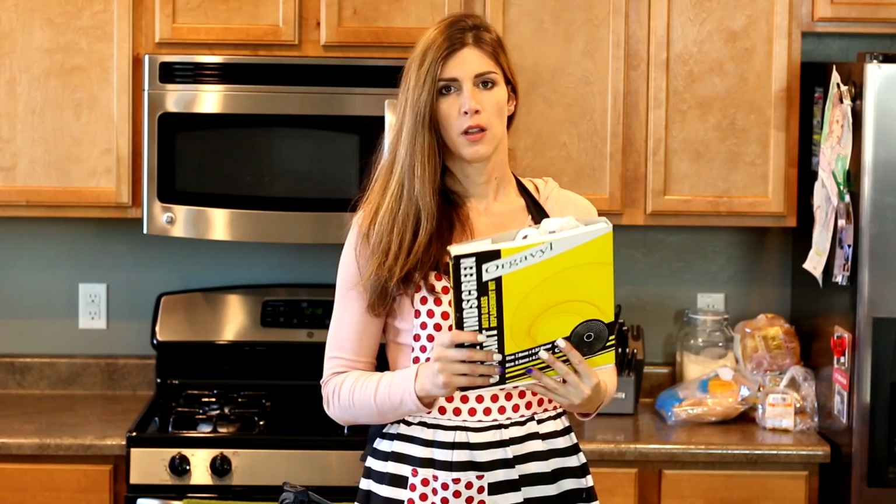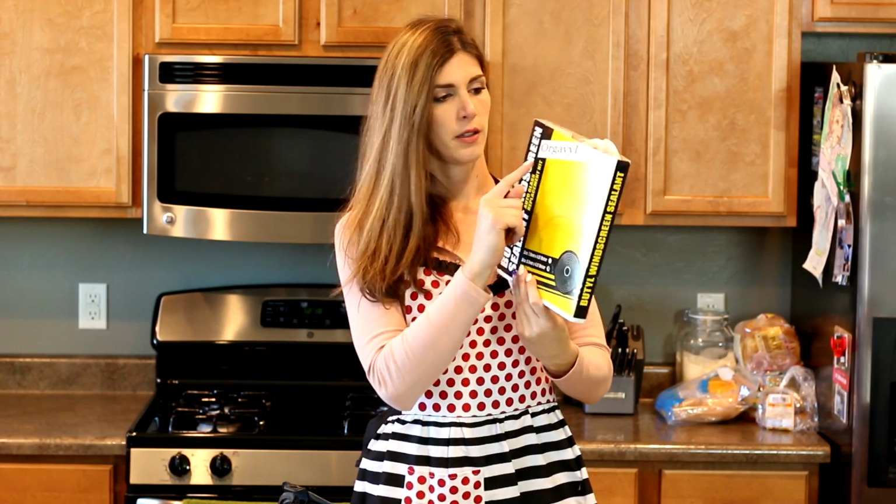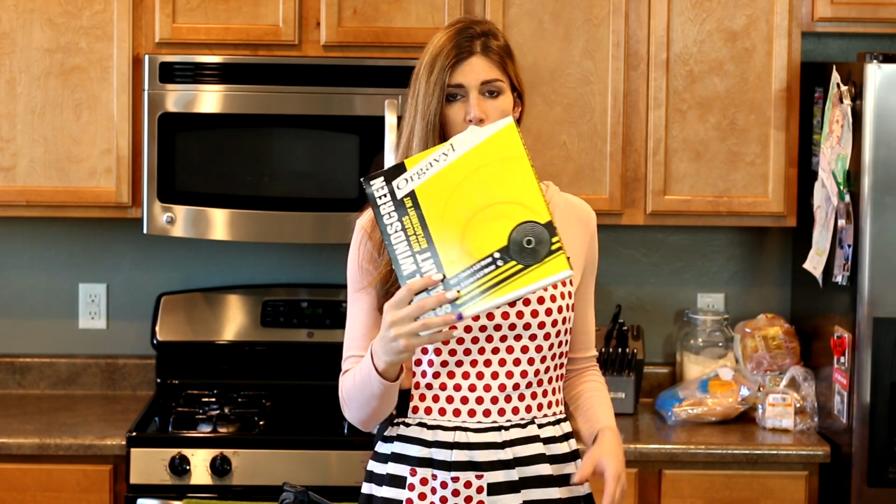Oh, you guys can't hear me. Low key, I thought this said organic at the top. I was like, oh, it's organic. This is what you want to use to reseal the headlight when you go to put it back together. Now these headlights leak a little bit; moisture was in them when I got them. So even better. You can use like RTV, I guess, like silicone RTV, but this is the correct stuff.